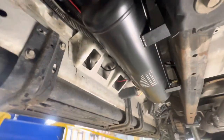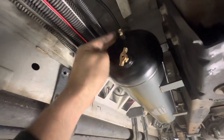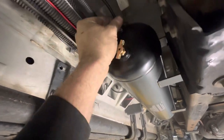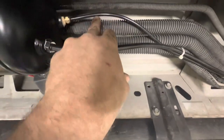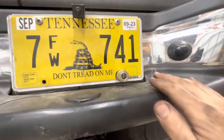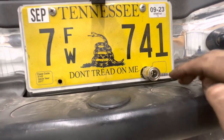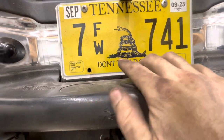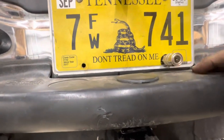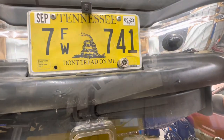So we put the tank drain here. This line goes out to our gauges up there, and this one goes back to our airline on the back of the truck. He wanted his air chuck convenient to get to, so we put the air chuck right here on the back bumper — before this, it had airbags and both air-ups for the airbags were coming out of there. It's easy to get to and you're not bending down under the truck. So we put his air chuck there.